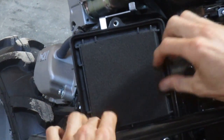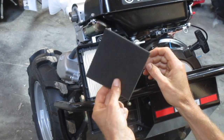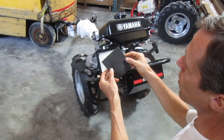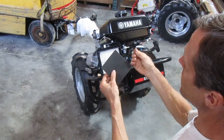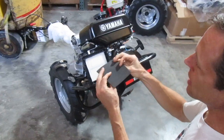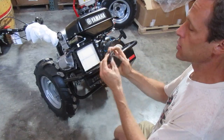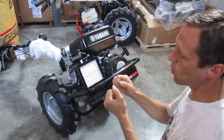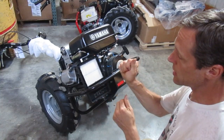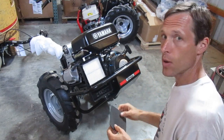Before this is fully assembled, I'm going to put a little oil wetting on this foam. Any kind of foam in a filter system has to be oil-wetted, otherwise it's kind of useless. This one comes from the factory with a little bit of oil on it, but it's not really enough. So I'm going to put just a dollop of motor oil on this, then squeeze out all the excess oil. Any additional oil that comes out after I squeeze it into a tiny little ball is too much. Then I'll go ahead and put it in here, replace the cover, and we're good to go.